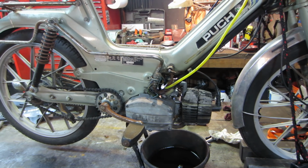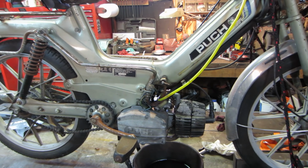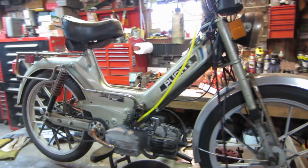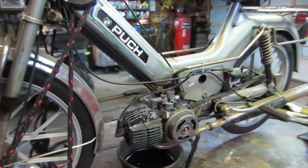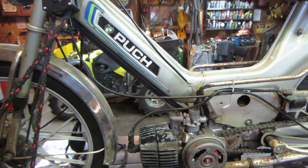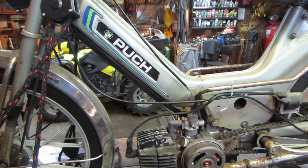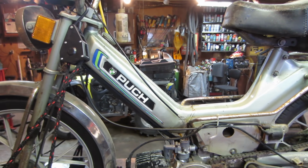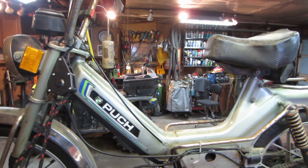But it looks like Dellorto makes a 15 millimeter carburetor that can go almost a direct fit on there, probably except for the air cleaner. And I'm probably going to go with them, and I think they're around 25 bucks. I think a couple of you guys wrote and put a link to those carburetors, so that's probably the way we're going to go. I have not quite ordered that yet, but we have enough to work with right now. The throttle cable will be another 3 or 4 days, and once I order the carb, it'll probably be about the same. But we've got stuff to work on.